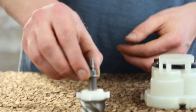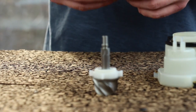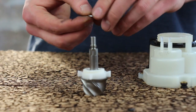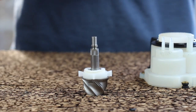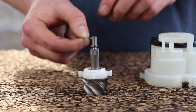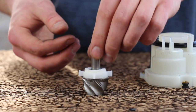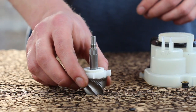I'm going to use one big thick one at 1.5mm, plus two medium ones that were already in the grinder for 2.5mm total. My GB 2.0 kit came with extra washers, so I'll use two of the skinny ones as well. That gives me 2.5 plus 0.25 plus 0.25, totaling 3mm of washers underneath the paddle wheel and cone burr.